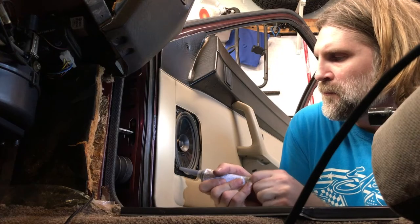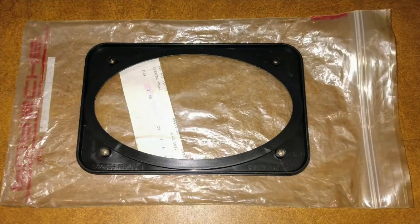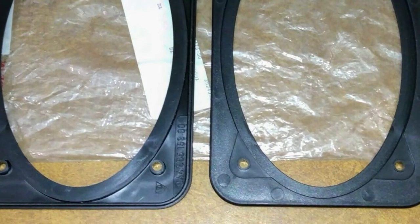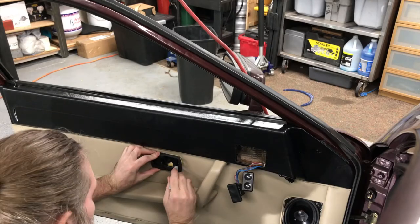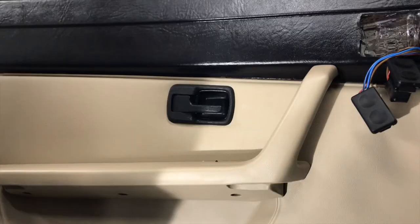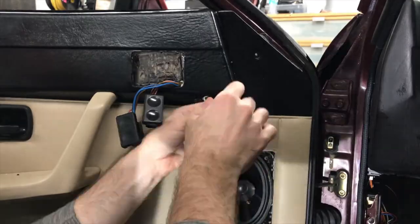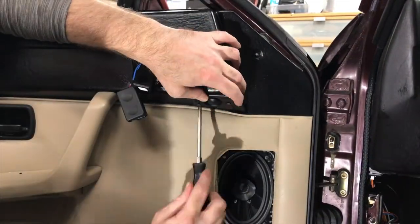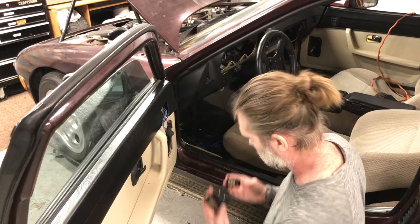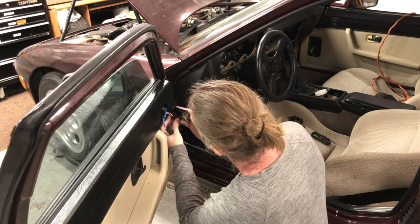I used the Permatex silicone and squirted it in behind there on both sides. The silicone held the washers and the baffle on the back of the speaker together and actually worked pretty well. I found some spacers online that Porsche probably switched to in later 944s — if you got a pair of those you wouldn't need to deal with the small nylon spacers or the silicone at all. Part of the problem is that the speaker frames I have are bigger than the hole in the door panel, so you need to take the panel on and off to remove the speakers. The factory speakers can be pulled without removing the door panel. In the end it worked out really well.